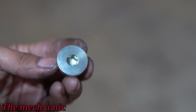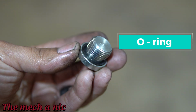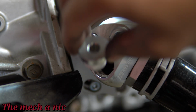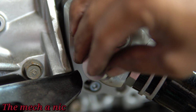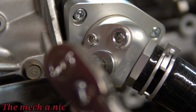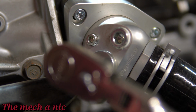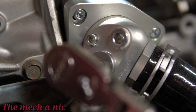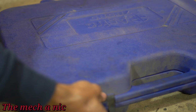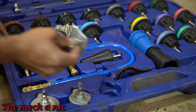Here I have a BMW oil pan plug, and you're probably wondering, why do you need that? Well, the K-tuned thermostat housing has this port on it, which for the longest time I didn't know what I was going to do with. Some people put a temperature sensor in here, but I've also read that you don't want to put your temperature sensor here because you won't get accurate readings off of it. So someone please leave a comment if you know what I should do here. In the meantime, I'm going to plug this off, and it just so happens that the BMW oil pan plug fits perfectly.